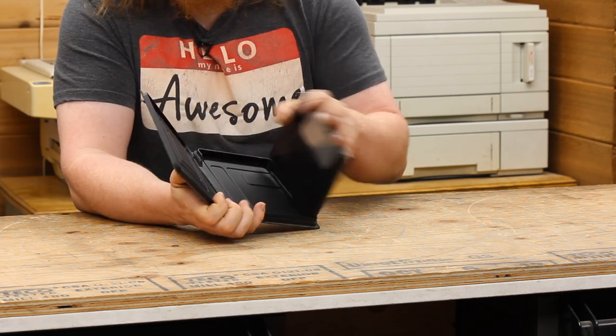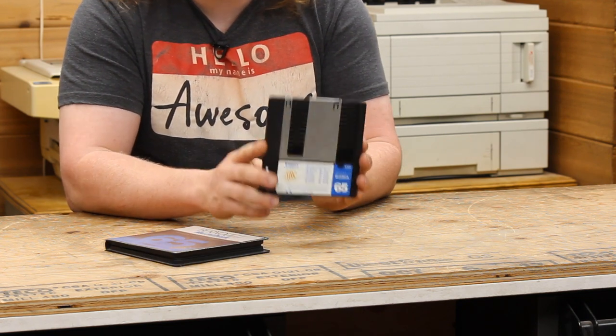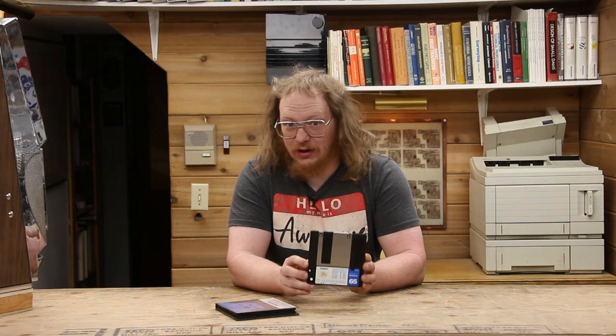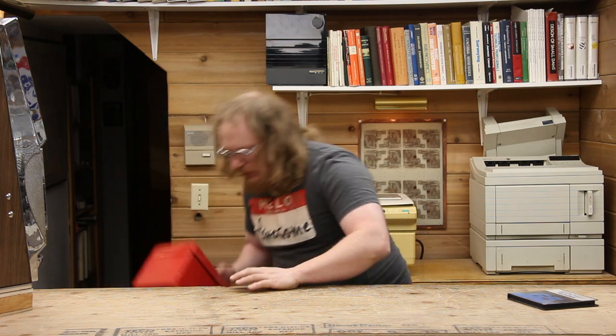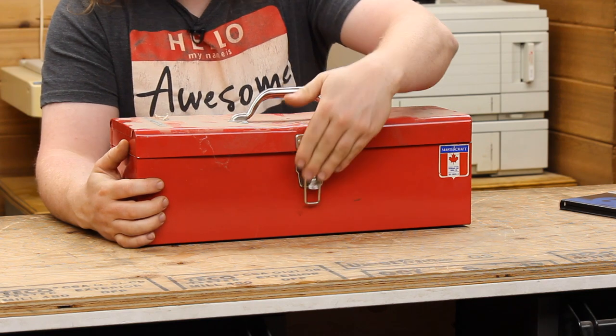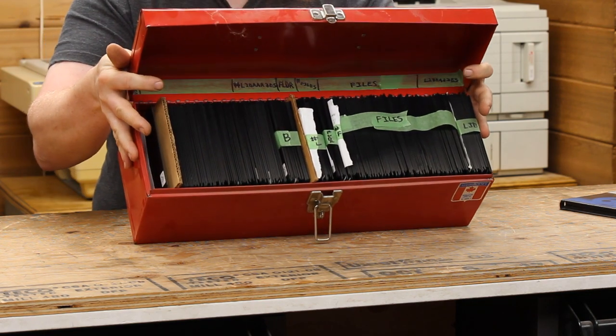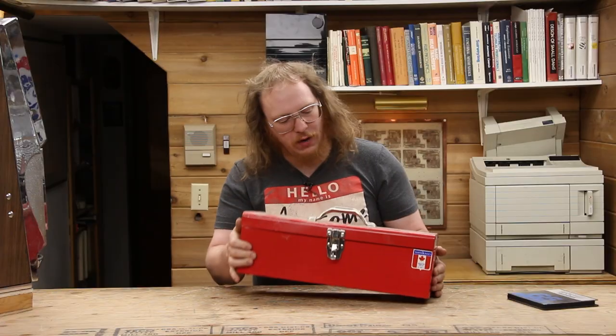This is a 65 megabyte Bernoulli cartridge. It comes in a fairly rigid, durable plastic enclosure. It has a safety lid and looks kind of like a floppy disk. It didn't sell all that well, however, because it was considerably expensive. There was also the super cheap method: MS-DOS came with a backup program which lets you back up your system to floppy disk. The problem is that backing up 200 megabytes can require a fair number of floppy disks, which becomes quite bulky and frankly quite impractical.